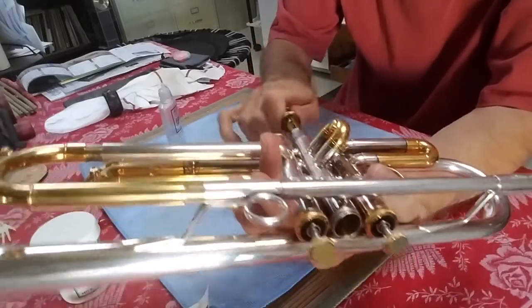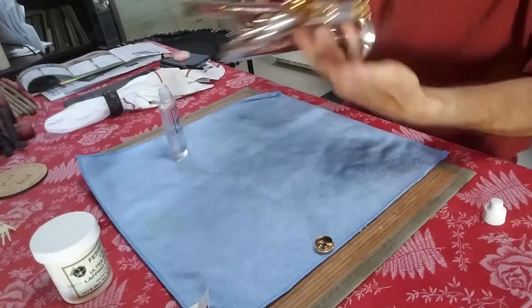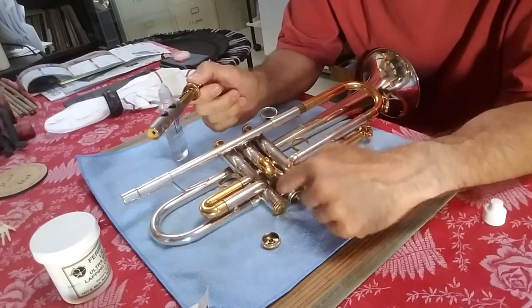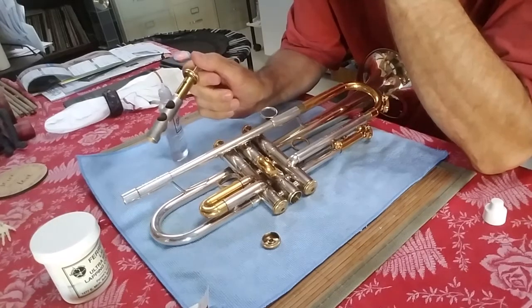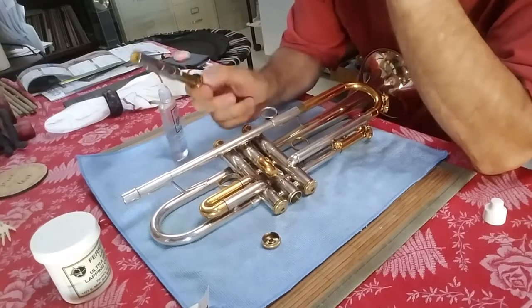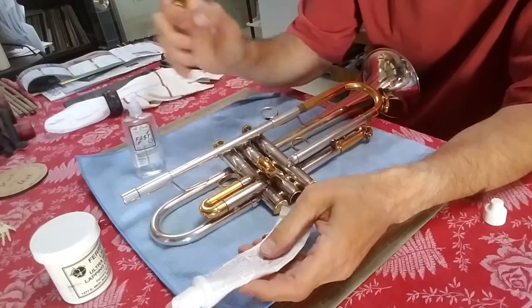You can see there's a little stick point near the end there, so the bottom of that valve casing needs a little work. I would probably wipe the valve down and also wipe the inside of the casing down, or clean it really well before re-oiling and then putting the valve in normally. You can do that more than once.